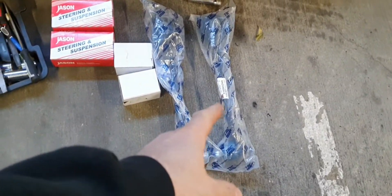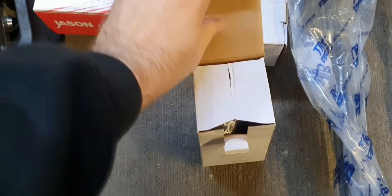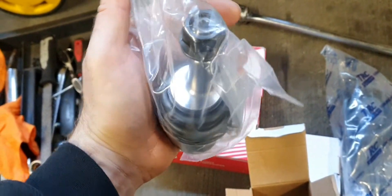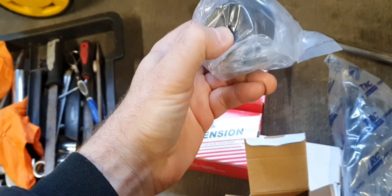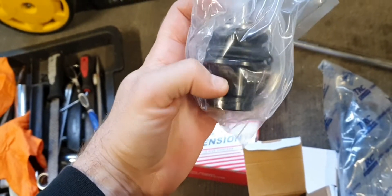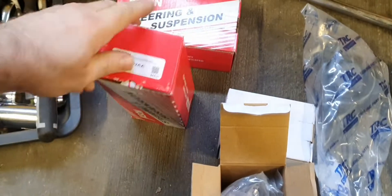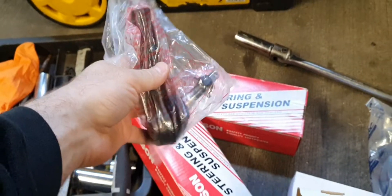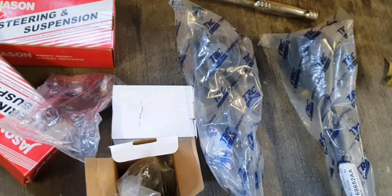So I've got two front arms — the bushes on the front arms are gone, as are the ball joints. I've got two sets of them, hopefully at a good price. As you can see it's offset on one side, which means you can adjust them. The hole there — the nipple goes in there, you can service it, put grease in there. That is a rod end. So I've got to change two of these, two ball joints, and two arms, so the front end will be sweet.